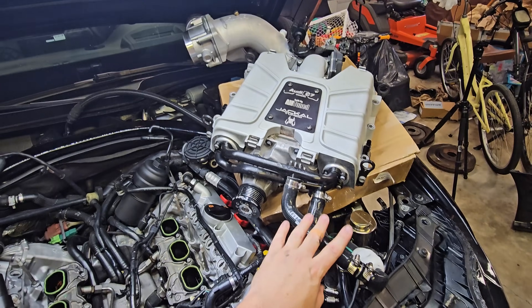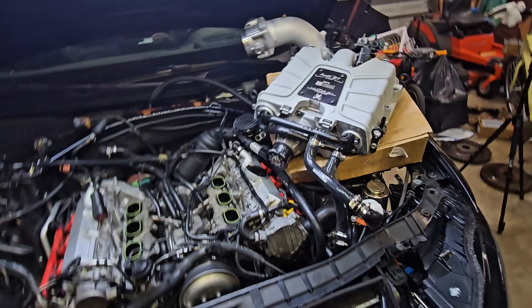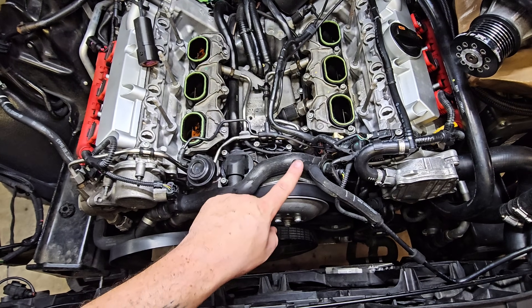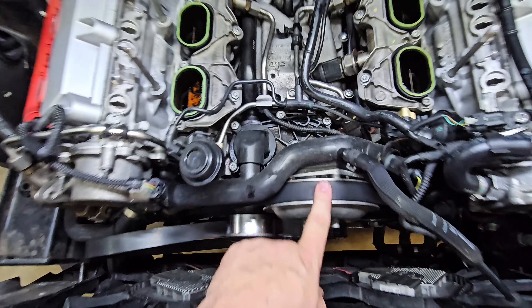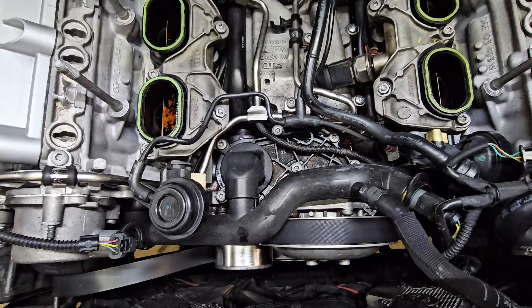Pro tip: if you've got a divorced setup for your cooling reservoir, you don't have to remove any of the hoses — you can just set it off to the side. In service position I've got my water pump pulley still attached with the belt. You can see down here some nasty crudiness and leaking coolant because my housing is just shot, so yeah, that's a great time to replace this.